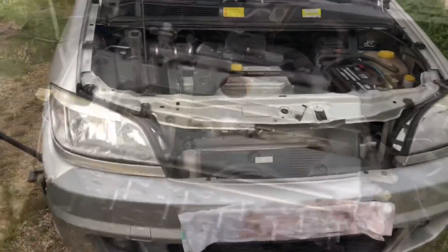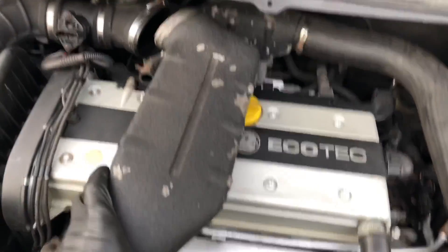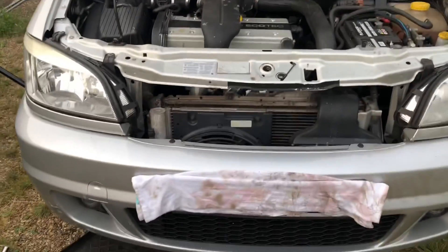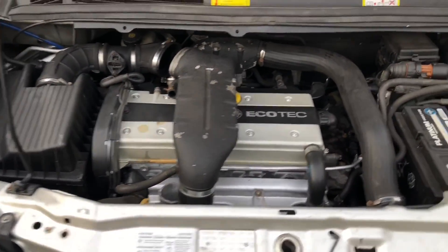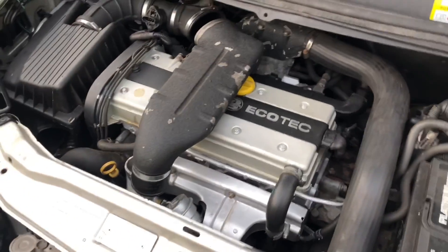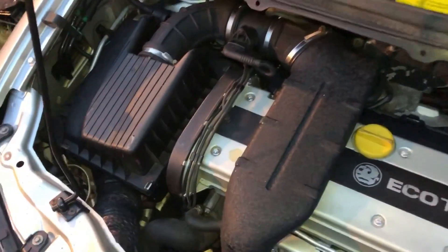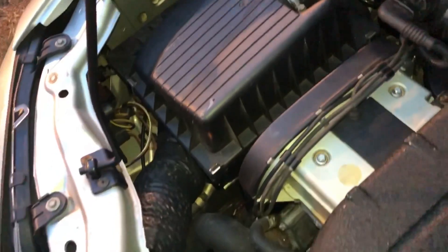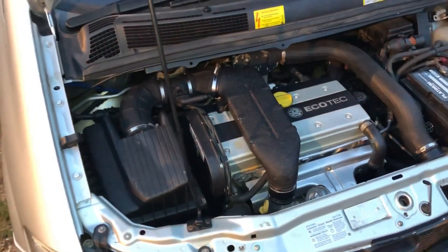The cams are in, cam cover's on, just timing up the cam belt, and then we've got the inlet on with injectors in. Just bolting on the rest of the bits - nearly all back together. Just gonna change this crossover pipe because it's a bit manky - I've got a nice clean one off the cars where I take them off for the crossover delete. I also couldn't help myself - I put a panel filter in the airbox and de-restricted it, and stuck a Spectra larger intake pipe on there. I just can't stop tinkering with engines, but every little helps.